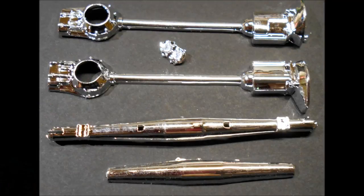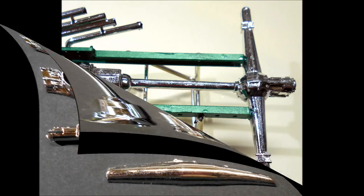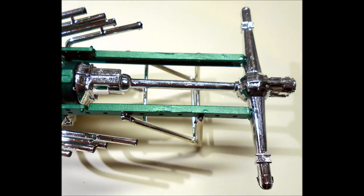Now let's assemble the drivetrain by adding the rear plate. Then assemble the axle. Now install the axle into the drivetrain with the holes towards the front. Install the completed rear drivetrain with the transmission hole on the top and attach the transmission to the motor and the axle to the frame ends. The drivetrain should be centered in the frame rails.